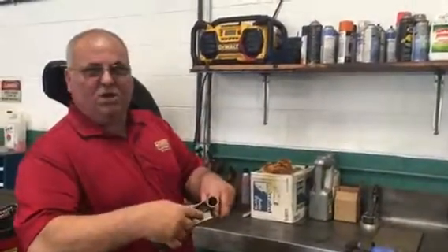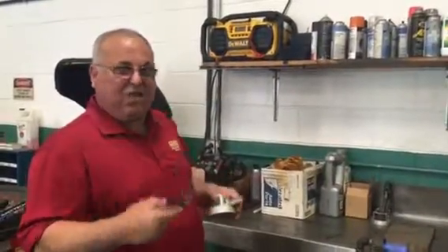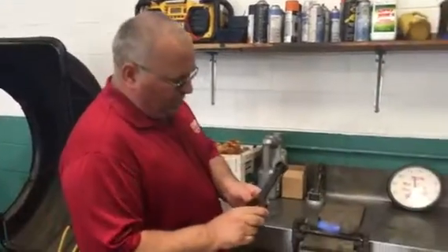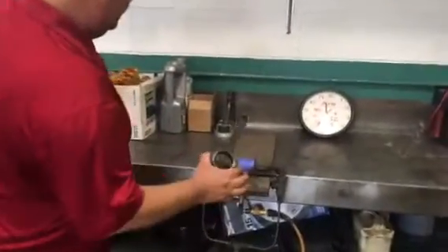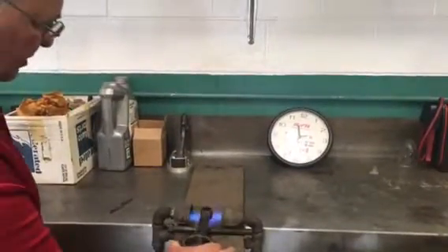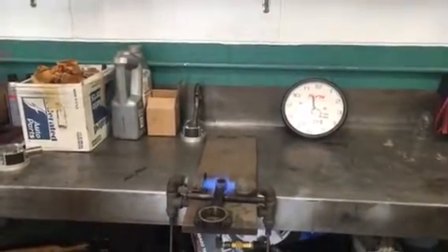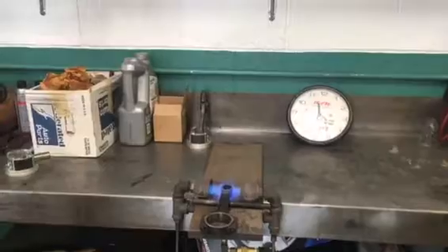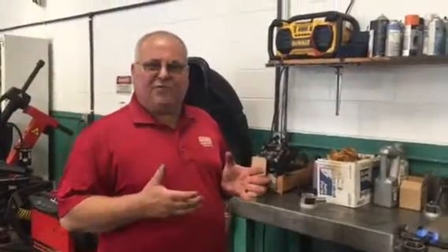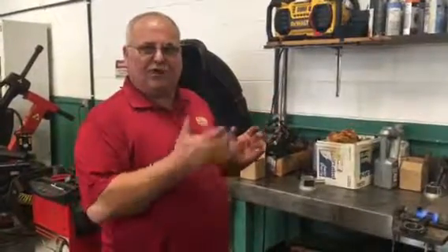What I'm going to do is keep this rod on for 45 seconds. It will not go on cold — it will expand until I stick the wrist pin in and push it through, and when it cools it will grab it. So right now we're going to stick this on for 45 seconds. This is a safe way to put these rods on when you push the wrist pin through, so you don't have to press them in a vice or a press — sometimes you break the piston. This way it expands and slides it right through.